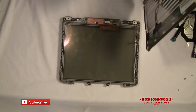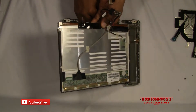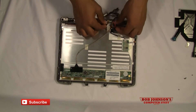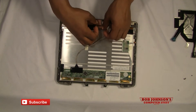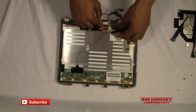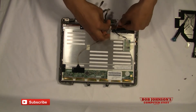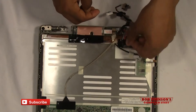Once that's all been replaced, the next step is reinserting this back into the cabinet. I would place my inverter board in front of me, pull back this heating sheet, and just slide the touch screen back into the front cabinet. Another thing to do is lift up this tape here and then replace that electrical tape over the heating board, so it's a bit easier to maneuver.